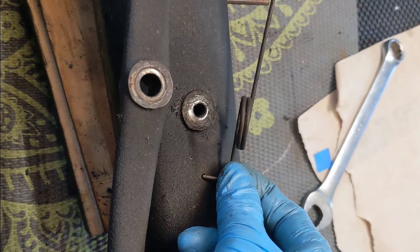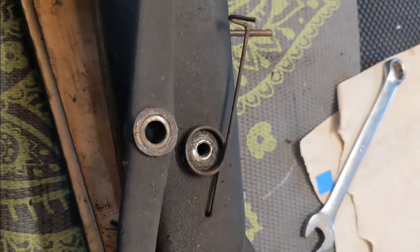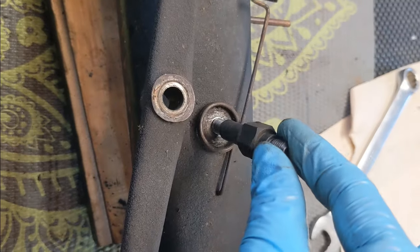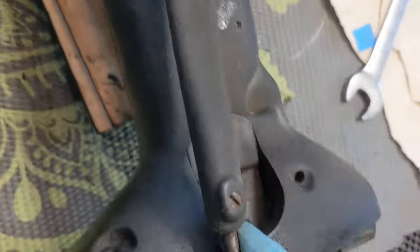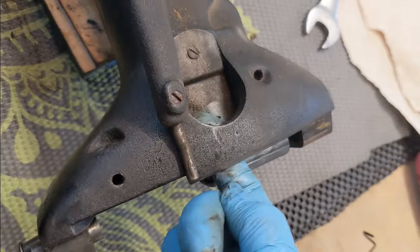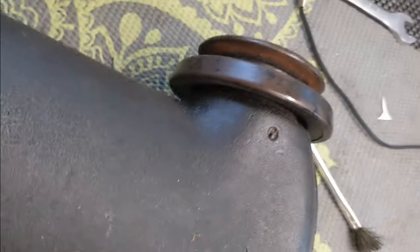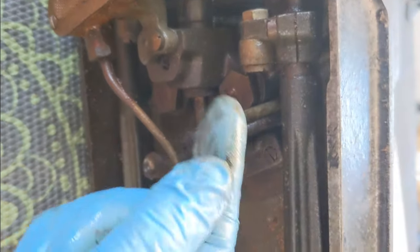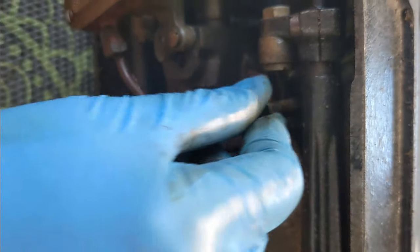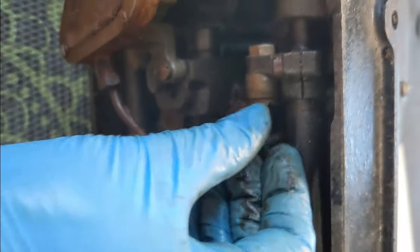This little bent part goes in that hole, centers over there, and this goes in like so. So now that that is out — this is that little end that we saw in here. I can totally clean that. And down here below the knee lifter — down below — has a little plunger that pushes up on here. So that's how this works. Let me see if I can just pull it straight through. I have to loosen these nuts off so I can pull this little brass shaft all the way down through the bottom.